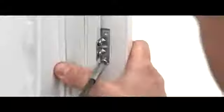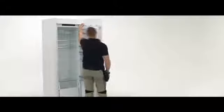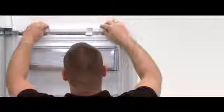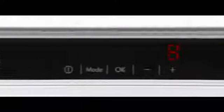Using the screws provided, fix the door to the fridge brackets on the right hand side. Repeat the process for the left hand side of the door. Now you will need the two washers and nuts provided. Place into position on the adjustment screws and fix into place. Next you will need the 11 white plastic covers provided; clip into place. Now you will need the white plastic top cover; clip into position on top of the door bracket. Your installation is now complete and ready for your customer.